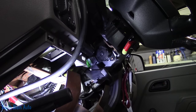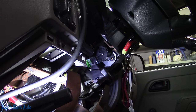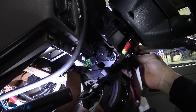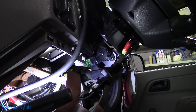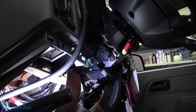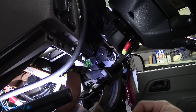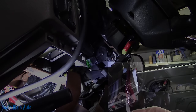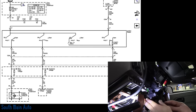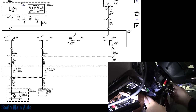I'm going to rerun through my checks real quick. Here's our ignition switch — I have our column covers off. It does not start, there are no codes, everything else seems as it should. It won't crank. The theft light is on solid but no code. So let's double check this. We should have full-time power on pin number two, white with black stripe.